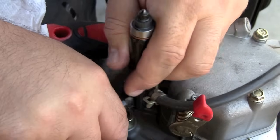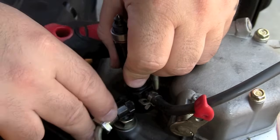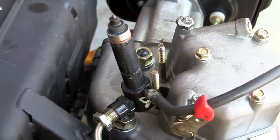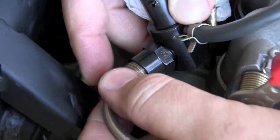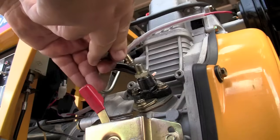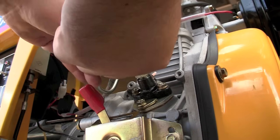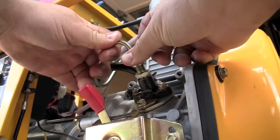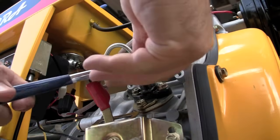There is another line on the fuel injector — a rubber hose — don't worry about that. You want to reconnect your high-pressure fuel line here. I'm actually reconnecting it because I want to crank the engine and see the fuel injector spraying fuel in four directions. In order to do so I got to flip it upside down and reconnect the high-pressure fuel line. The other end has to be reconnected — possibly bend the fuel line again just to get it to line up. Reconnect it back to the fuel pump and make sure it's good and secure, otherwise fuel will leak.